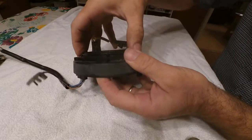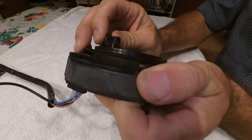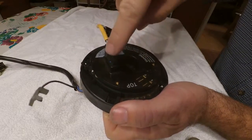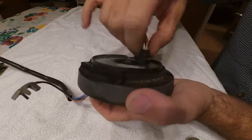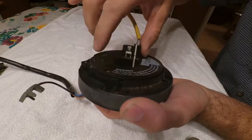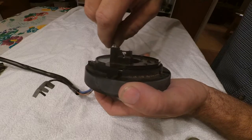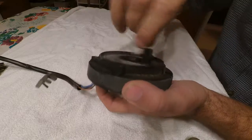If you look closely inside of here, it's just a long band. It plugs in right here, wraps all around here, and then connects to this. Now if you take this clock spring and spin it one way, it's made to go a certain amount of turns one way and it starts to get tight — you know you're maxed out on the band. Turn the other way, it stops right there again, because you're maxing out the actual ribbon inside the clock spring.